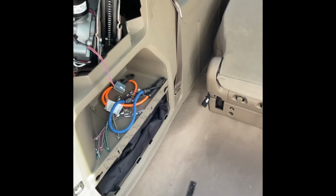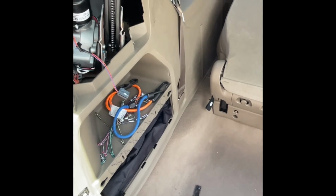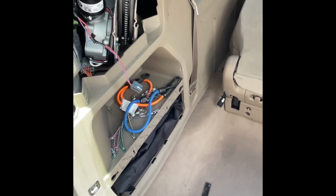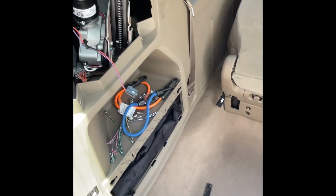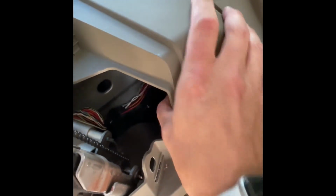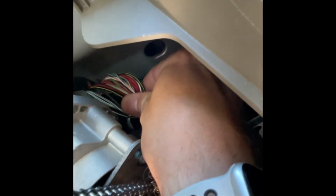If you have this van and any of the navigation doesn't work, like I said, the garage door, the vanity mirror, I don't know what else is all tied into it. Definitely pull this apart and check. So I'm going to actually finish pulling this panel off and get in there, and like I said, I'll try. You can kind of see it right there on the red wire, but that was touching the metal case. It just vibrated because they ran the harness right up against it.